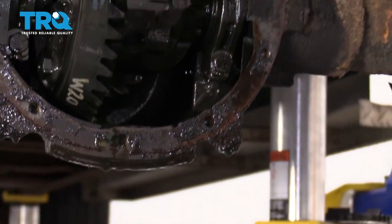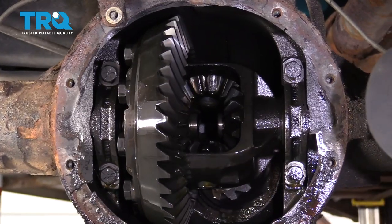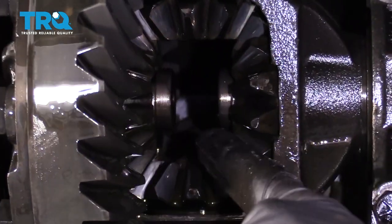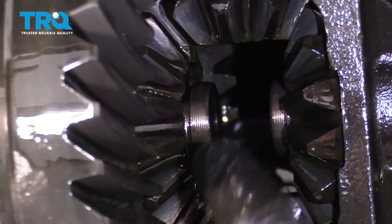The pin is hardened steel, so if it hits the ground it could potentially break. Slide that out. We'll put the pin with it and set it aside. Now we're just going to spin this a little bit more so we have clear access to the inside. I'm going to push the axle and watch right here — this clip is going to come dropping out.